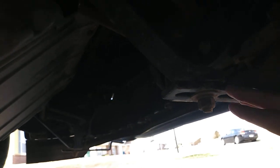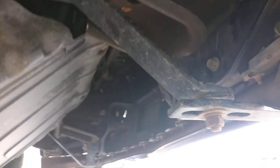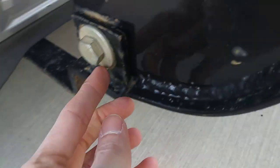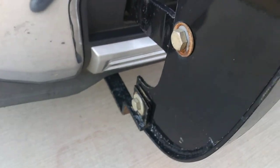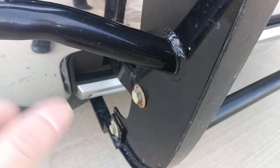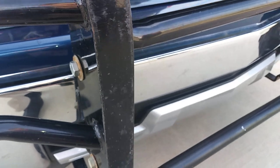You don't want to have these all tightened up so that you can adjust the actual brush guard itself — keep those a little bit loose. You can do this all by one person. These brackets down here have a little lip on one side, so you're able to just put the brush guard right on there. I held it with my hands and my chest, then put in the bolts so it would be supportive. Then just adjust it how you need to and tighten down the bolts.